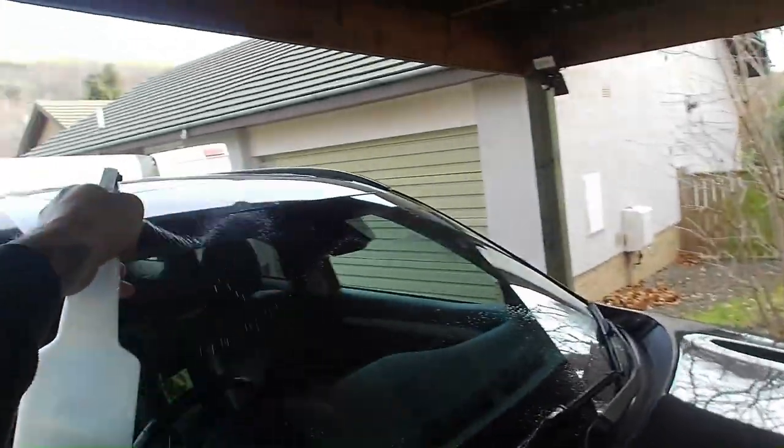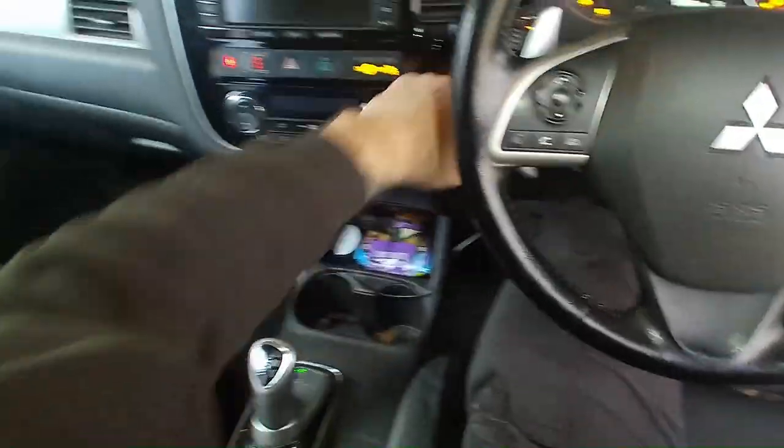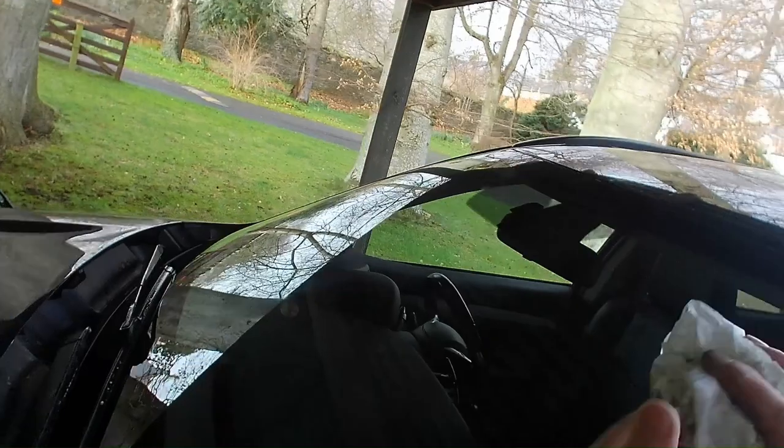Give the glass a clean-up and check that the rain sensor is working properly. Make sure the wipers are working in the correct position, and give the mirror a little clean. Put the wiper stock onto the auto setting, spray the rain sensor with glass cleaner, and you can see the wipers automatically come on. Just give it a final clean-up. The car will need to sit for 60 minutes before it's driven. And that's it — another job done. Thanks for watching.